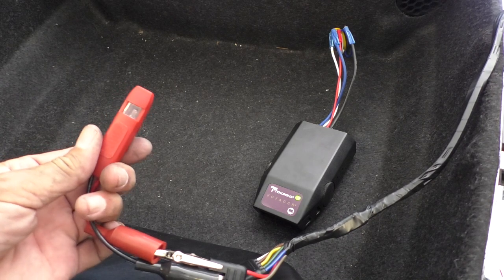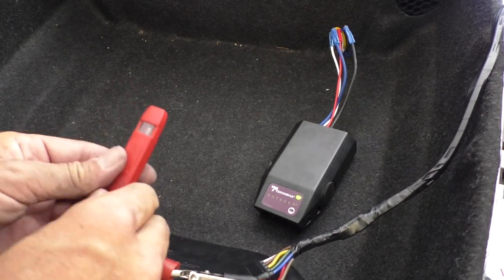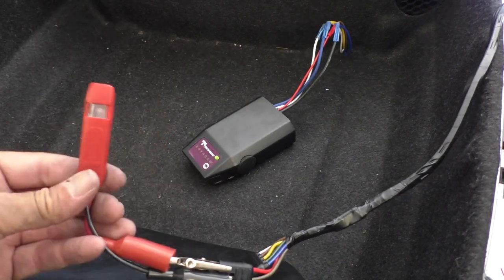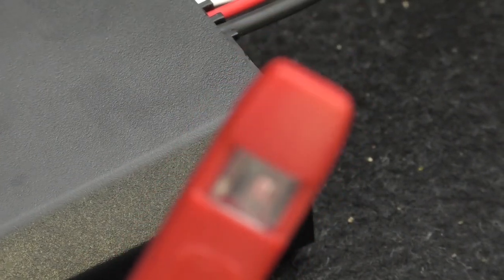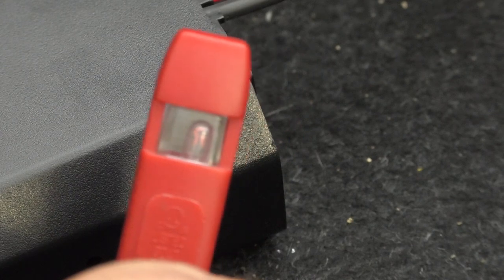Last, I'll do a quick test just to make sure everything is working. To do that, I've attached a test light to the two-pin plug. When I put that test light on the plug, the status light on the brake controller will turn green. And when I activate the manual brake slider button on the controller, you'll see the test light light up. I'm sorry the video here is a bit rough, but I think you'll get the idea.